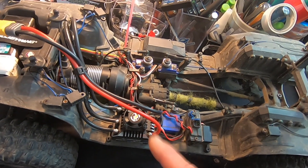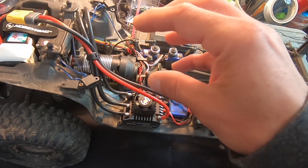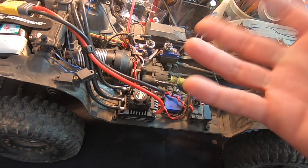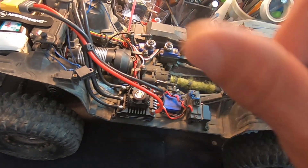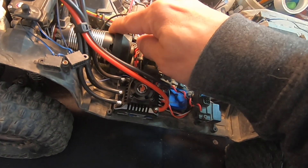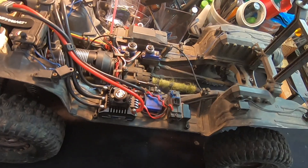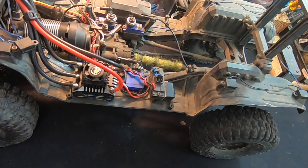The one topic to keep in mind if you're thinking about swapping motors: the 550 motors are intended to work with the version 1.1 hardware speed control — that's what engineering strongly recommends. To confirm you have 1.1, hook it up to Bluetooth; the hardware version is listed there and in the product listing. Most everyone has 1.1s unless you got your AXE very early on, in which case you're probably already in love with it anyway.